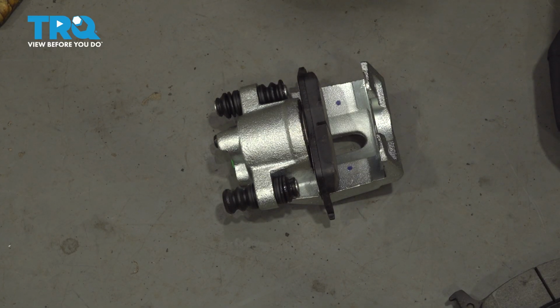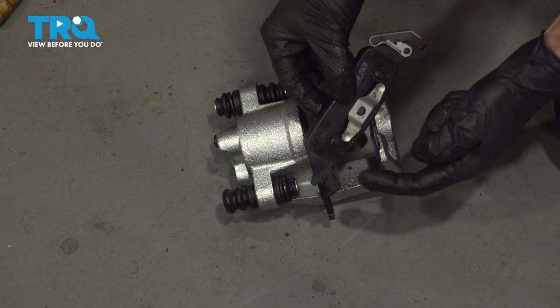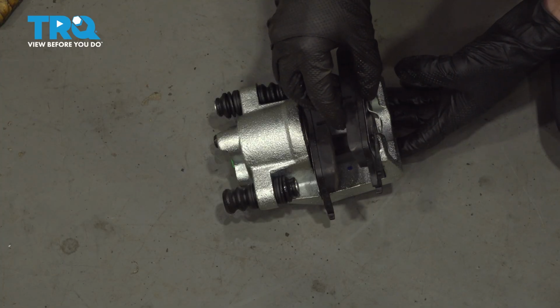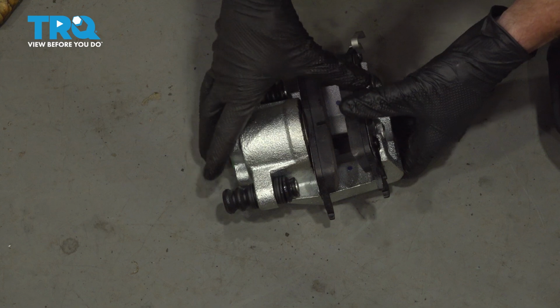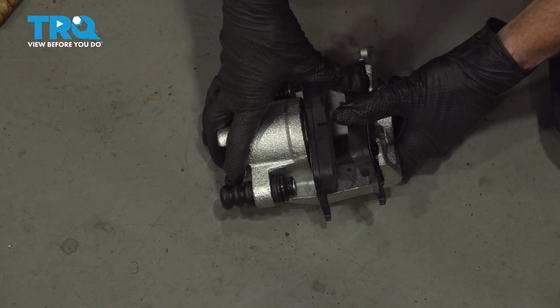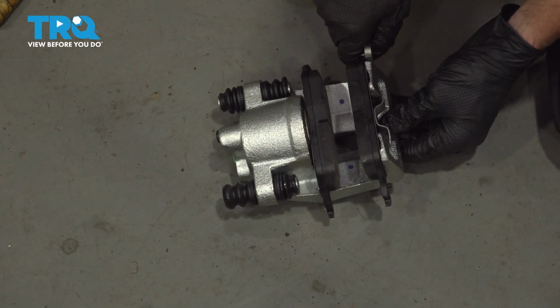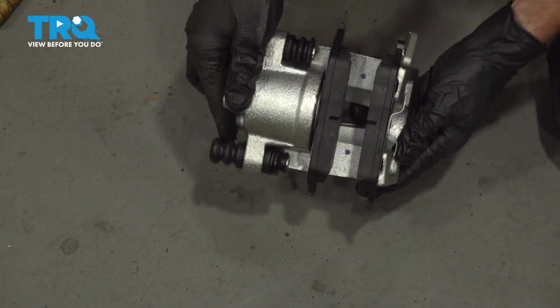It's time for the outer brake pad. Now for this, we want to make sure that we have the 2 locating tabs on the brake pad itself aligned with their circular ports. We'll take this. We have our locking ears on the outboard side. Slide it in, listen for a click. Double check to make sure it's completely seated and placed properly. Let's get this on the vehicle.